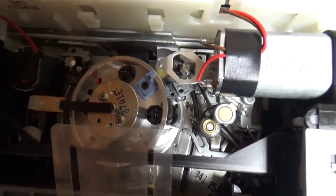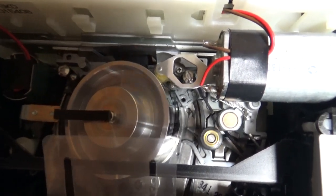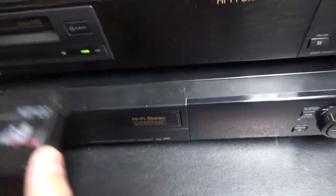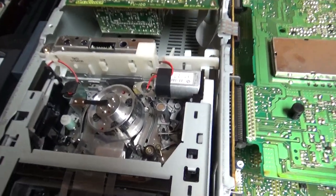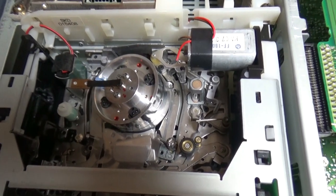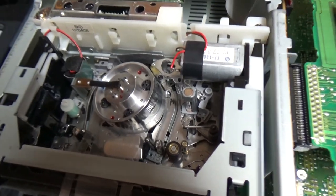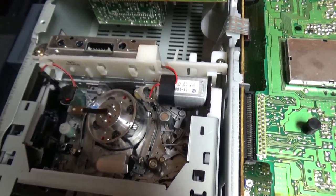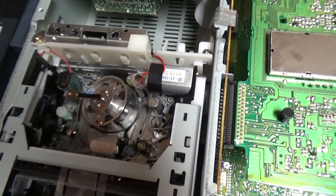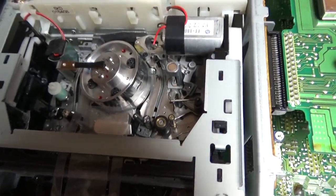There's a head cleaner that makes contact with the drum when the tape loads and unloads. Something I wanted to mention is that this mechanism is quite similar to the MiniDV mechanism found in JVC S-VHS / MiniDV combo decks, like the one the VCR King has. The mechanism is pretty similar because the VCR King's MiniDV deck also has a motor placed like that — a separate motor for the front-loading mechanism and the loading motor at this location. So this is something similar.